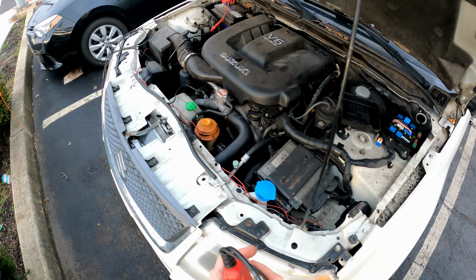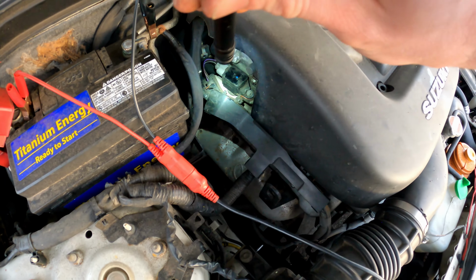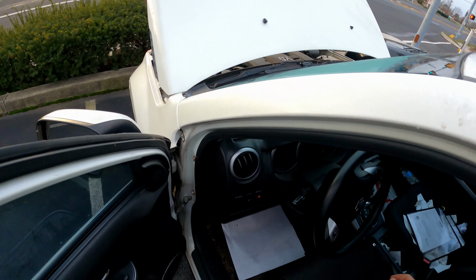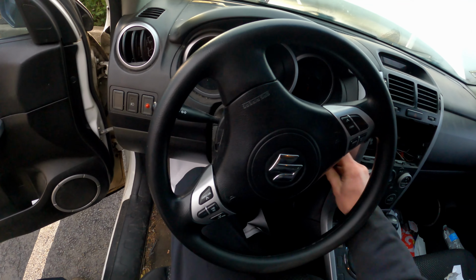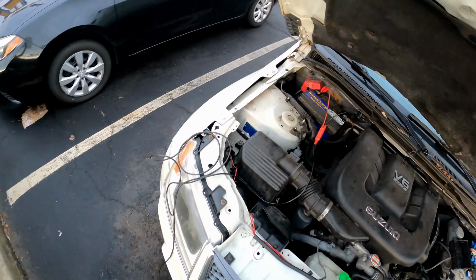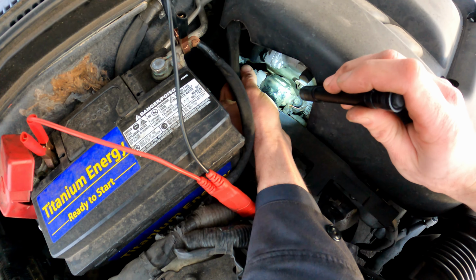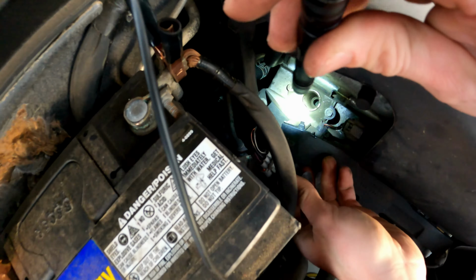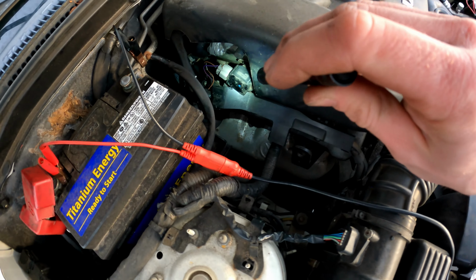Whoa. Like a blow. Let me just shut this off. Definitely sounds like a motorcycle, and I could see, yeah, it looks like a spark plug blew out. So if you're seeing what I'm seeing, hopefully this light works okay. The ignition coil is cracked off completely, and the spark plug's blown out. Look at that. All right, that's a simple find.